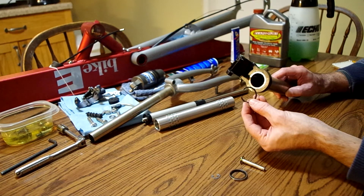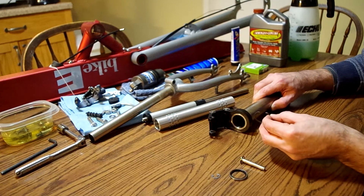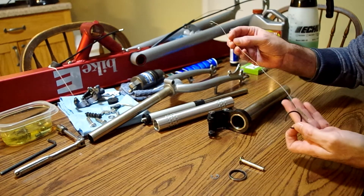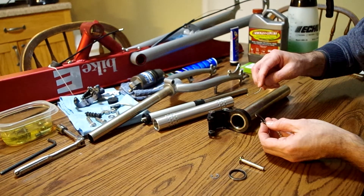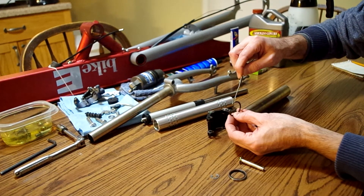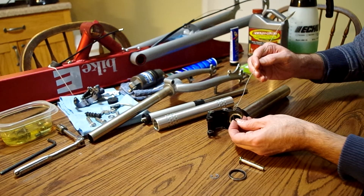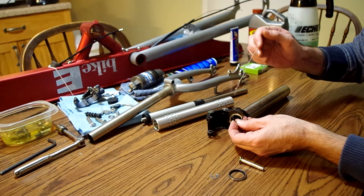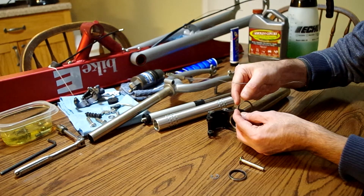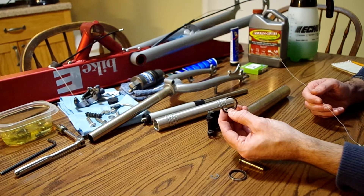There are no holes on it to attach snap ring pliers. The best way I figured out to get this thing out was I ended up using the end of a little scrub brush — but a piece of piano wire would work too. When it was in there, I was able to wrap the end of the wire around one end of it and wrap that around my hand a couple times. Then you can hold it and keep it from spinning while you get a screwdriver under the other end and pry it out. Typically you would just use two screwdrivers on this style, but there's just not room to work in there on this one — but that did work.